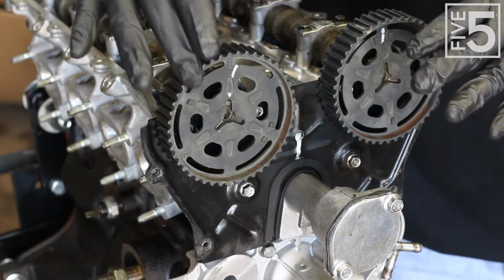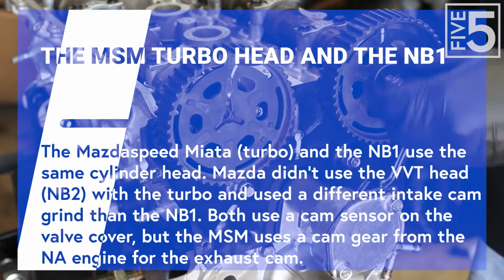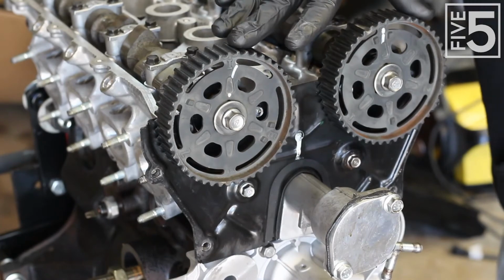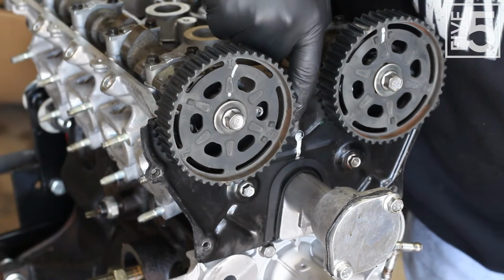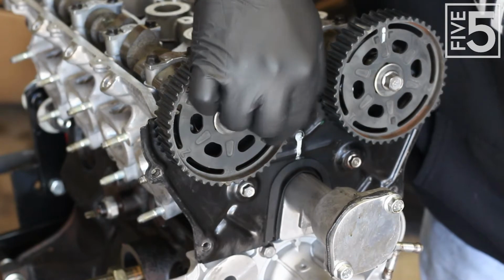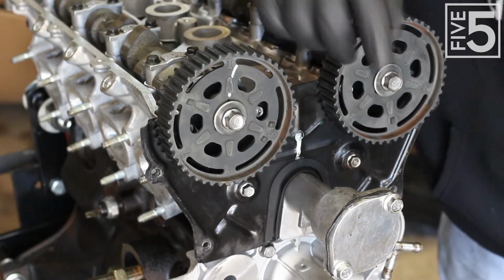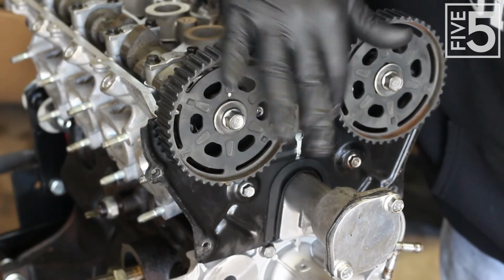So you can go ahead and put in your bolts and tighten these down. Now, once you got these on properly, you also notice here on your timing cover, there's an E and then there's an I on this side. And they will correspond to the marks on your timing gear at that point. So this should be pointing to an E, and the E is right there. And over here, it should be pointing to an I, and the I is right there. And that's how you know these are set up properly. Once you have that all done, torque these to 37 to 44 foot-pounds.